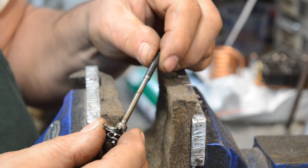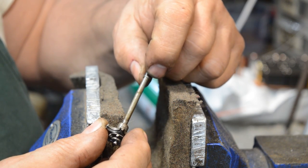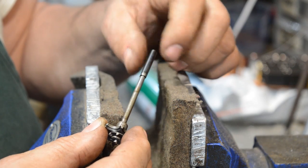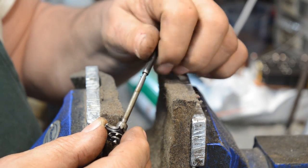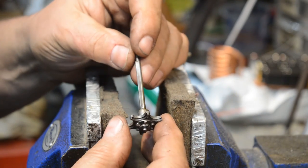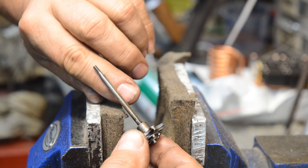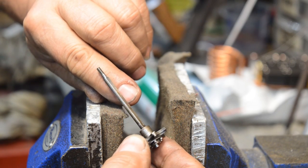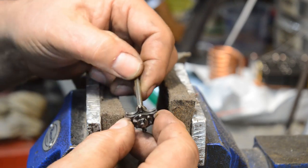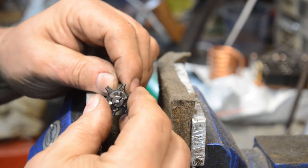I'm going to put a little bit of blue Loctite on that and do something to jam that up. We might actually confine this right here just a little bit — take a tubing cutter and make a very slight line to give it some drag. That came off, and now we're left with this strut. There's a flat spot on it right there — it's shining. That flat spot is what keeps this thing from rotating, and it's been beat up pretty well at both front and back.